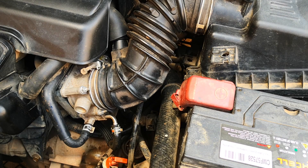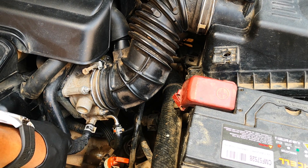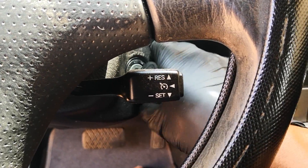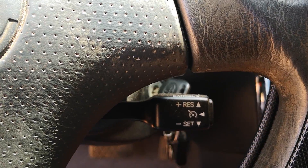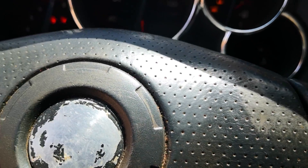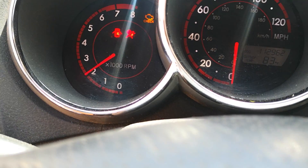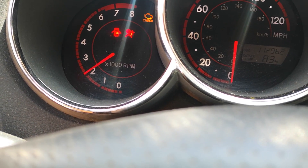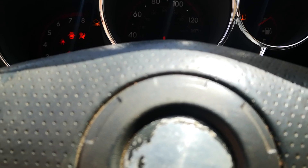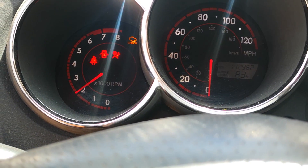Next thing is to relearn the throttle and also to bleed the cooling system, since air has gone into the cooling lines from the hoses that we disconnected. We're going to start the car up. That's normal — usually Toyotas after cleaning the throttle body will do all these kind of funny things. I'll disconnect the negative battery terminal, leave it for five minutes, and then come back and relearn the idle. That usually takes care of it.